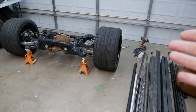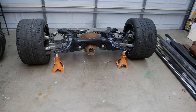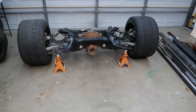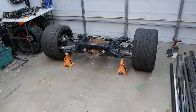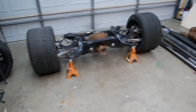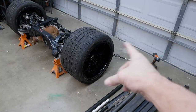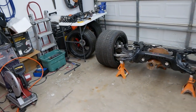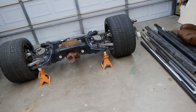One of the big main reasons I went with this is that it's a very wide rear assembly. I needed something super wide because I widened the body to 78.7 inches, and this suspension with tires measures 78.5 inches to the edge of tires — so that turned out to be perfect. It should fit on the body without needing different wheel offsets. I like these wheels because they're essentially centerline wheels — the brake and rotor is pretty much exactly in the center of the wheel, so all the rotational mass is right in the middle where you'd want it.